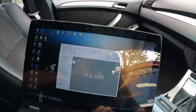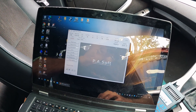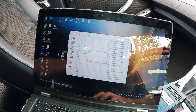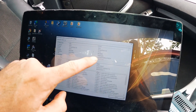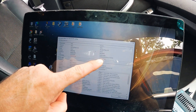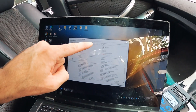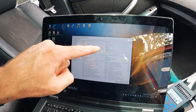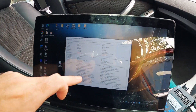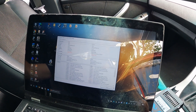While we've got this software here — we'll exit this part and go Car Identify again, Continue. So this should read everything. That mileage is still off — a bit bizarre but we don't have a Tamper Dot. I might check in a day or two and see if the mileage between the IKE and the EWS lines up, or if you guys know why the EWS stopped counting when we changed the light control module let me know. Interestingly in this software it's classed as an X5 Alpina 4.6 — there you go. Let's take it for a quick test drive.